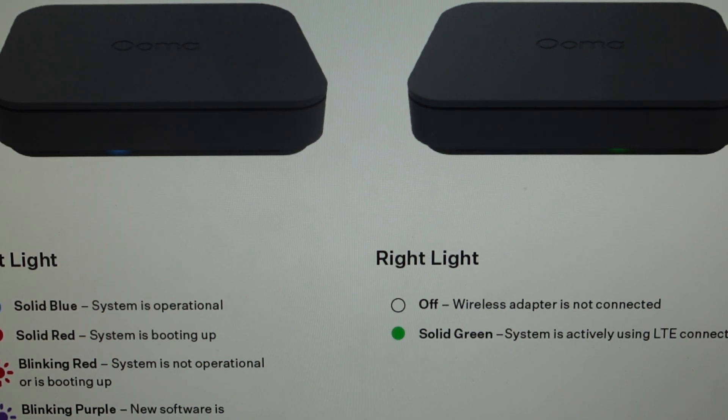We're just going to press down that reset button while we restore power to it and turn it back on, then just keep the button pressed and it will go through a reset cycle. The LED will turn solid red, then green and red, then solid green, and the speaker will make two popping sounds, then the LED will blink red and blue, then return to solid red.